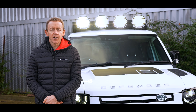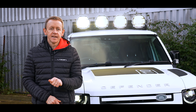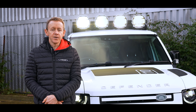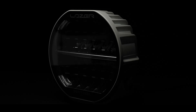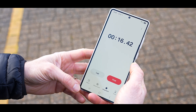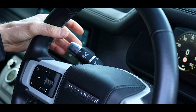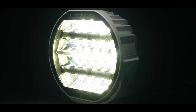In case the driver is in a country where regulations require them to always run in a lower output — the ECE approved low output mode — the driver can run the high beam for exactly 20 seconds, then flash the high beam off and back on 19 times.